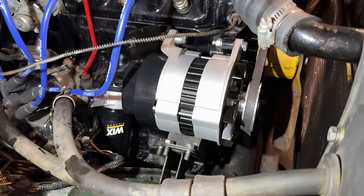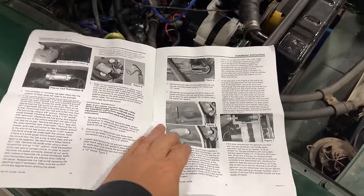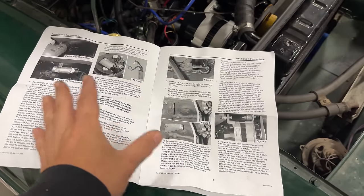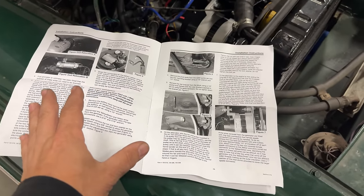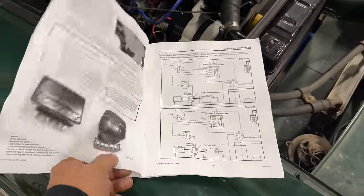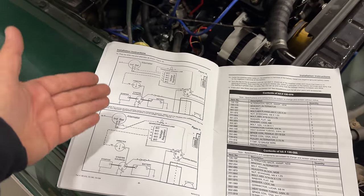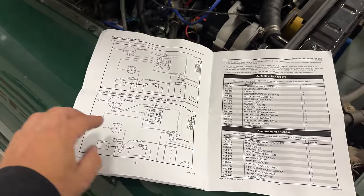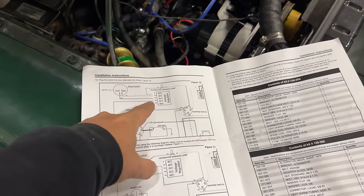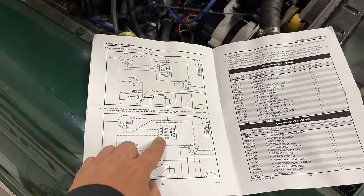Now I need to change the wiring at the regulator before we hook this up. I am not a fan of the instructions that Moss has sent with this kit. One of the problems is there's so much information here because this is covering both MGAs and MGBs, and things are also maybe going to be a little different on your car than how it's described here, and I don't think it's described very well. What they would like you to do is basically take all of your wires off of the regulator and then permanently cut the ends off of your wires to attach them together. So I'm going to show you how to do it more simply and in a way that's also reversible.